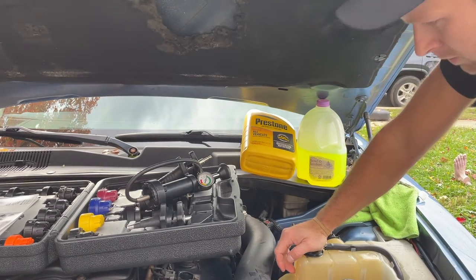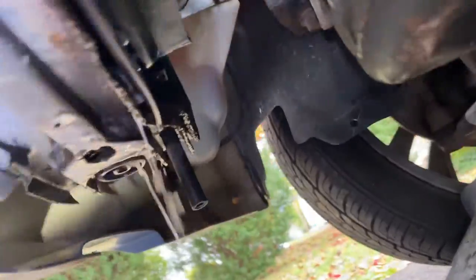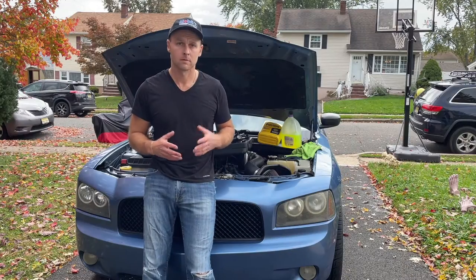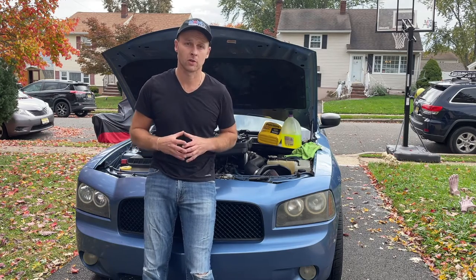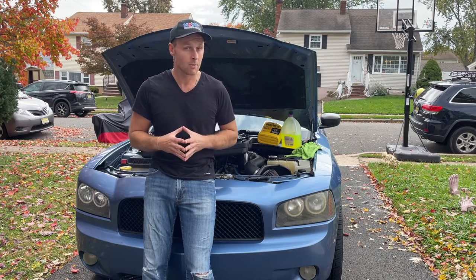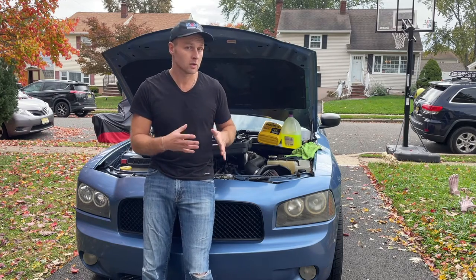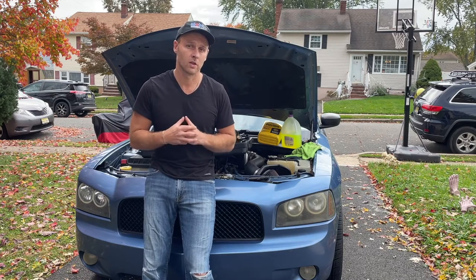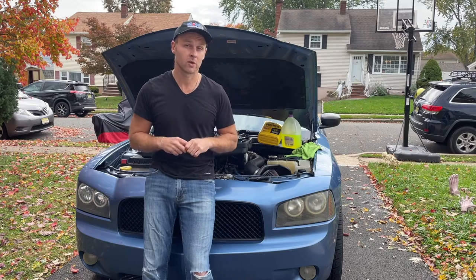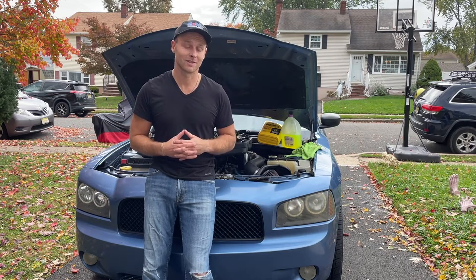That was exactly how this is done, guys. You don't have to run your car and risk anything getting overheated. I pressurized it again and removed the cover on the bottom of the bumper just so we can see — and as you can see, it's pouring out. The leak is definitely somewhere on the bottom of the radiator, behind the fan. So guys, thank you for watching. I hope this was helpful and will help you test your cars and move on to the next steps. My next video will be how to replace a radiator on a 2007 Dodge Charger. I'm probably going to replace the thermostat as well since it's a matter of time before that goes — and that could have been part of the issue, creating more pressure. At least two videos coming soon on this car. Please comment below if you have any feedback, questions, or comments. Thumbs up is appreciated, subscribe for more videos like this — thanks so much guys, have a good one.